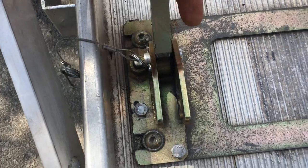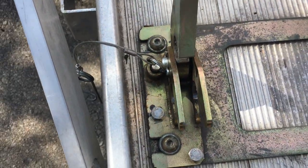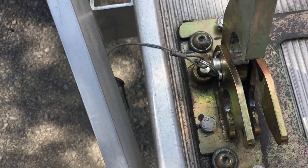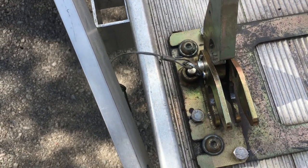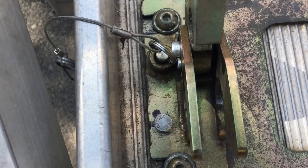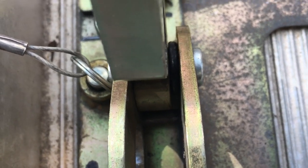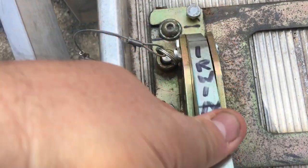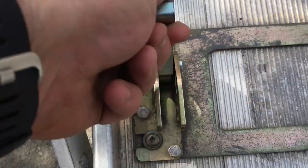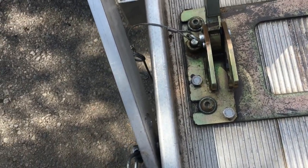What I did was I took out the pin — there's just a cotter pin on that side — and inside you'll find two very thin washers and a third washer on the outside. I took those three washers out and I replaced all three of them with one thick washer. What it did was take up all the side-to-side slop, which helped firm up that connection point.